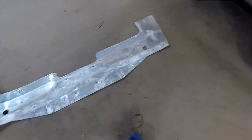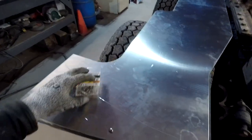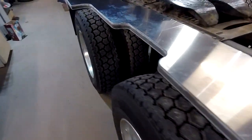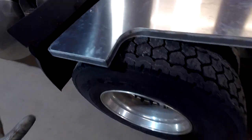We finally got the old inner skin out and the new inner skin installed — it looks really good. We're just putting two sheet metal screws into the new transom here to hold it, then we're going to put it in the boat and see how everything looks.